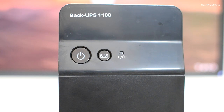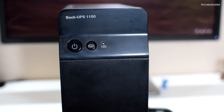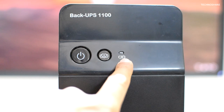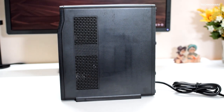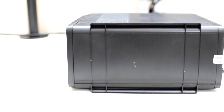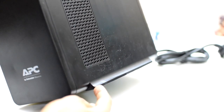If there are any errors, the LED will turn red. The second button is for the battery saver option. Pressing this button will activate the battery saver feature and offers consistent runtime during the lifetime of the battery. It increases the battery life up to two times, but the runtime of the connected equipment will reduce when this feature is enabled. Lastly, there is an LED that is a status indicator during charging of the battery. On the sides of the UPS, we see a couple of vents for cooling and dissipating heat. On the bottom side, the edges are elevated and protrude outwards, helping in stability when the UPS is in standing position.